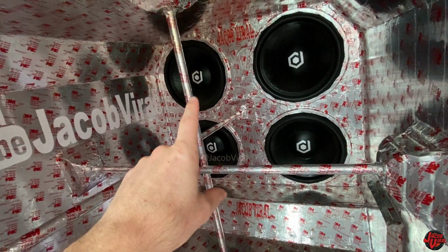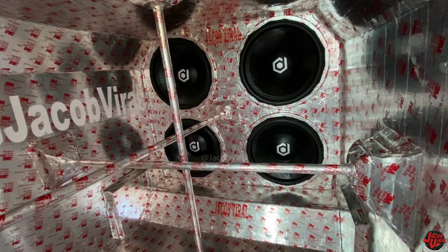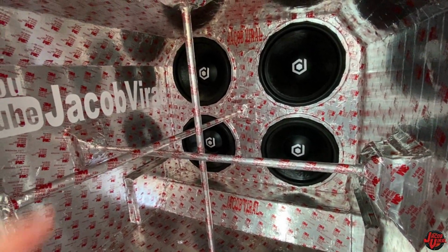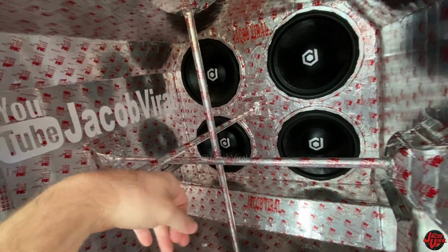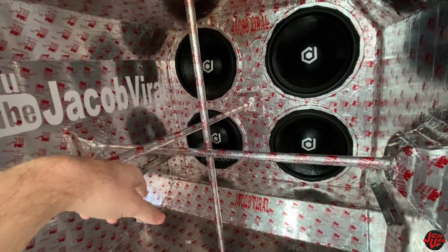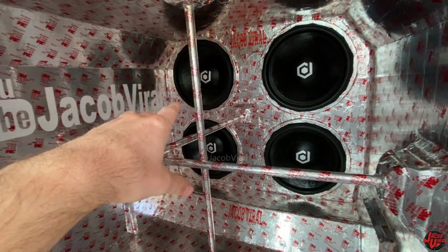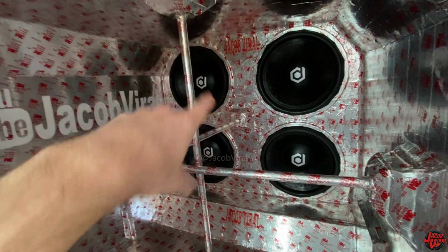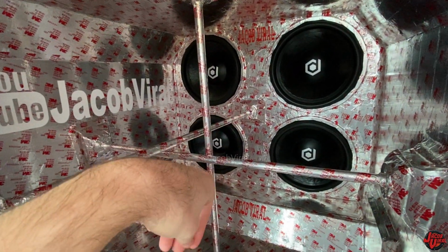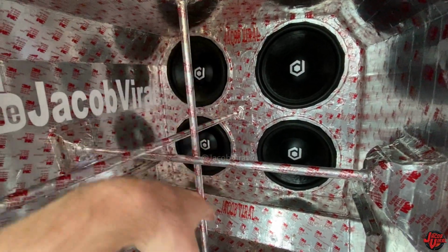And these subwoofers are 4-inch voice coil, rated at 2 to 2.5k RMS. They really could take 5 to 6,000 watts on clean power, and I'm not even giving them more than 1,800 to 2K at max, on a clip burp almost, with what I have. So my goal is to lower my budget. Right now my budget's a little too high for this system. So I'm going to be taking out my subwoofers, my amplifiers, and one of my batteries. I want to revamp my whole system and equipment for next year.